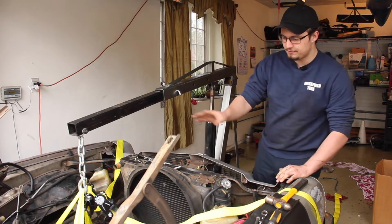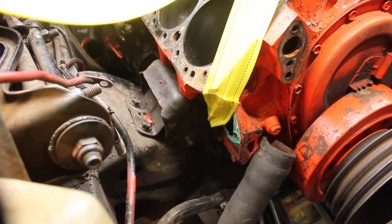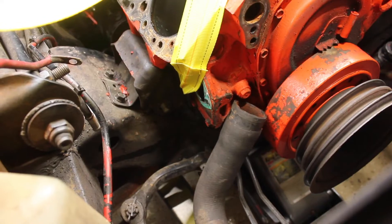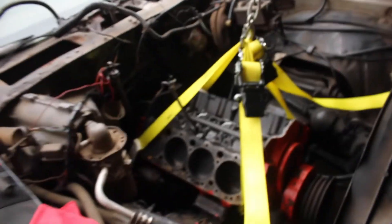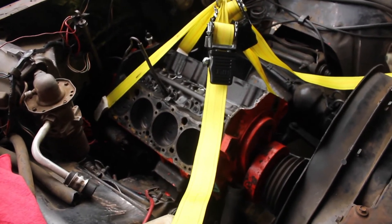Now I'll show you the four mounting points I chose for the hooks on the ratchet straps. Up here at the front I hooked the ratchet strap right onto the mount — the part that's hooked onto the engine block. It's not the strongest connection point but it should do the trick; there's no room for it to slip. Back here at either side of the engine there's a little hole bracket that you can slip your hook into very nicely — a nice solid connection. You can do the same thing on either side, creating an even distribution of the engine block's weight.